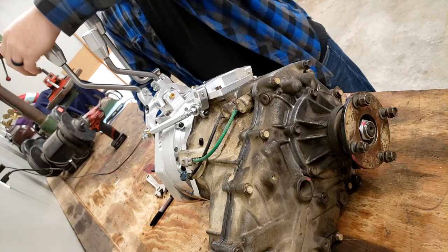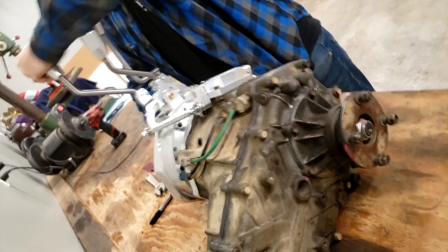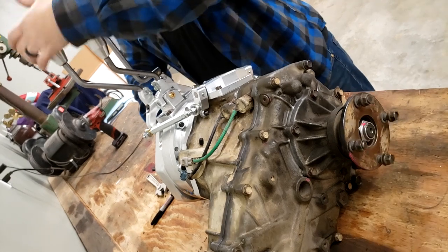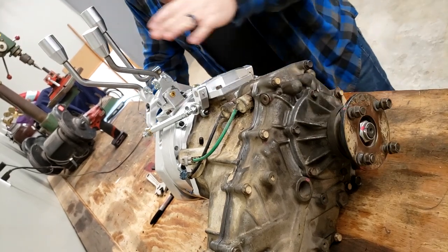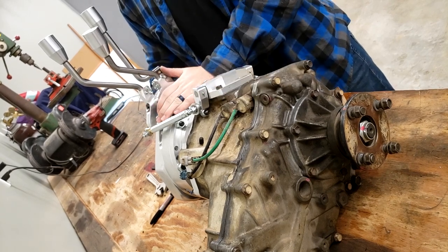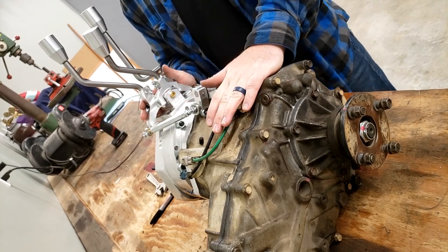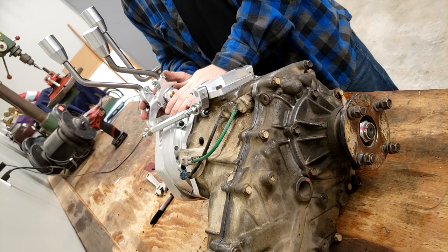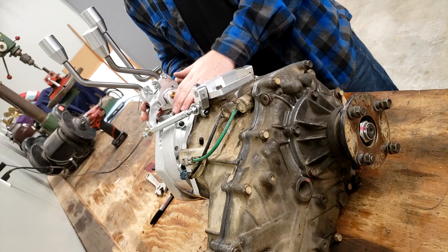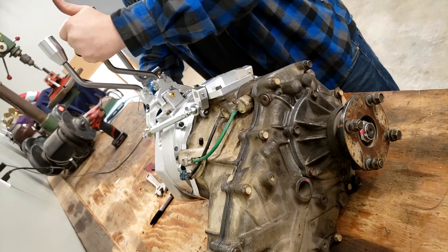The left stick is going to give you your rear case low range in the front. Neutral is one back. One more back gives you your rear case high range. You should be engaging your rear case low range before you ever use your front case. Doing your front case low range first will put a lot of strain on the rear case because it's multiplying the amount of torque you put through the cases. It's always safest to run the rear case first, and then if you need to really slow it down, then use the front case. So with this triple shifter installed, everything operates as intended.